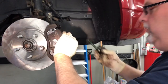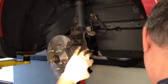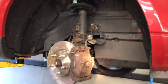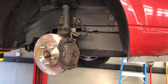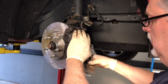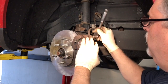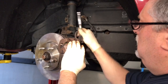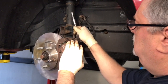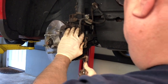Remember, the caliper pin with the black tip was the bottom one, so put that one in the bottom hole. Then the other one goes in the top. Take your ratchet and snug these up — when catching them you have to wobble the caliper a little bit. It's fine threads, so it should go in nice and easy. Before tightening anything up, make sure you've caught both of them.